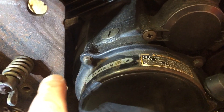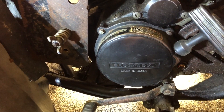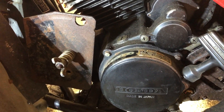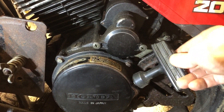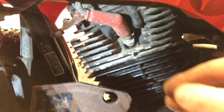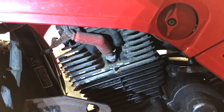On top of the pull starter you're going to see all the gears — looks like you've got neutral, one, two, three, four, five, and then reverse underneath neutral. This is an automatic setup, kind of like you put it in gear and because of the wet-clutch design you just hit the throttle and go, and you can stop completely without using a clutch. It also has electric start, but if you're pull-starting it you'll want to use the compression release right here.